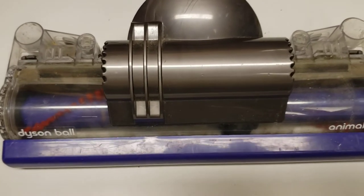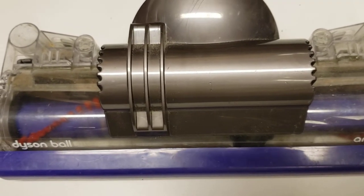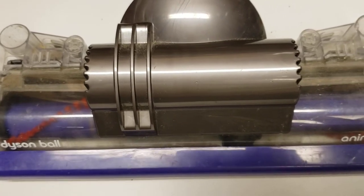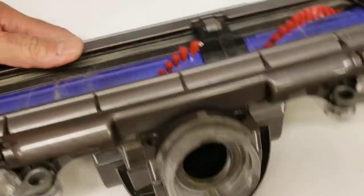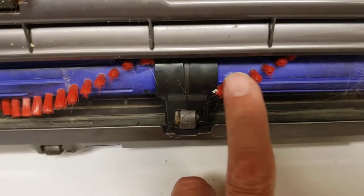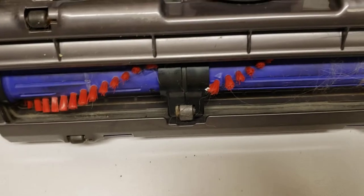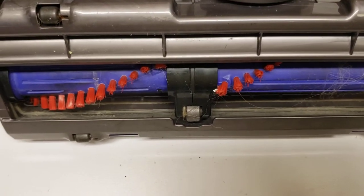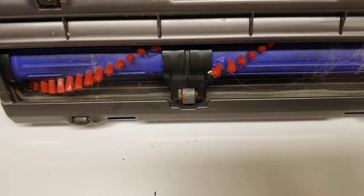The main issue is if you have a very long-haired dog — we have a rough coat collie; I'm sure a lot of very long coarse coats will do the same thing. The hair winds up around the bearing, gets down behind these areas, wraps around the bearing, and basically clogs or jams the bearing in such a way that it heats up, melts the plastic, and then the drive cog literally melts off of the motor.